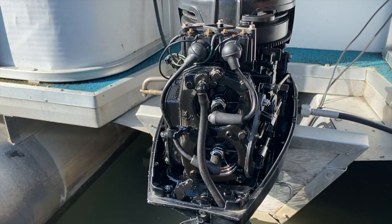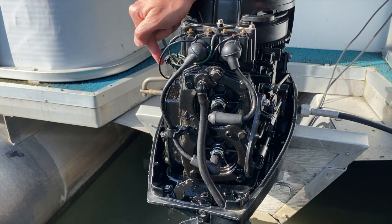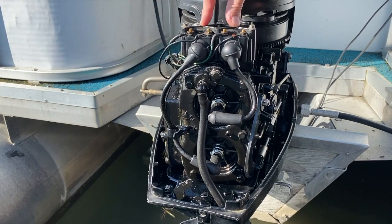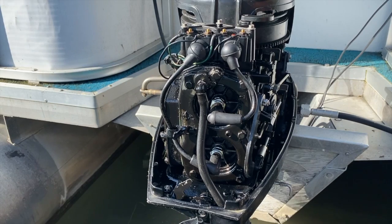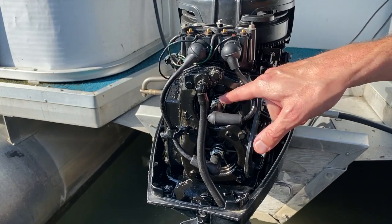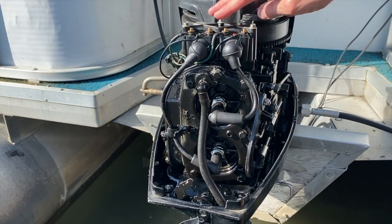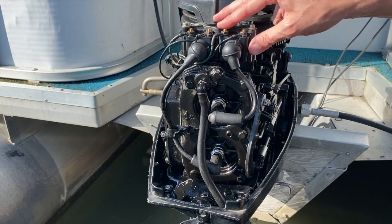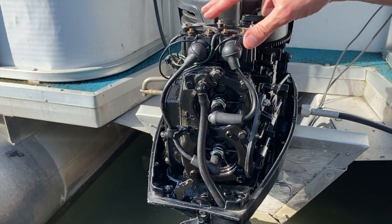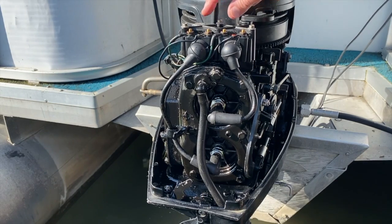So in the event that you have not replaced your ignition coils, it might be time — you might have a faulty and worn out ignition coil. While we're talking about ignition coils, let's go back to the switch box. What the switch box does: once you turn that key while sitting in the captain's seat, that electrical signal travels through all the wiring, makes its way back to the switch box, and the switch box sends that electrical signal to your ignition coils. The ignition coils then take that sparking power and multiply or enhance it significantly, sending the current through the spark plug wires, into the boots, into the plugs, into the cylinders, and to the electrode — a far more enhanced spark than without ignition coils. You wouldn't really be able to start your engine if you had faulty ignition coils, or your engine might turn over but you are going to experience aggressive shaking. So common cause number three: faulty, worn out, or cracked ignition coils. We will also have a link below on how to properly and safely replace your ignition coils — it's a pretty friendly project.